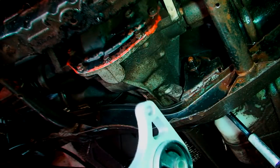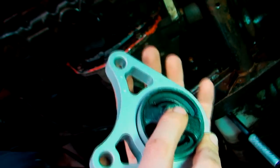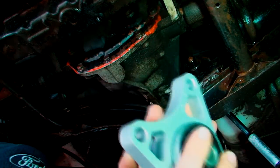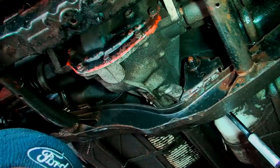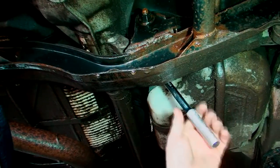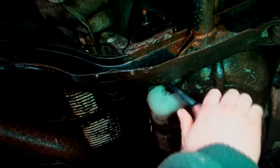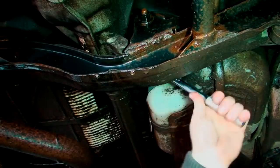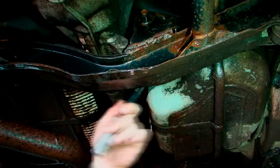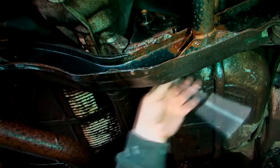I'm going to do the little one at the front first. I think this is what's causing most of the problems. But like everything, when that's really bad the two back bushings aren't going to be far behind it. So we're doing everything, which is the best thing to do anyway — then at least you know you're 100%. This is simple — famous last words. You've got a 15mm bolt that goes through the middle and two 13mm bolts that go on the diff. There's a captive nut welded on so you don't have to hold it, which is good.